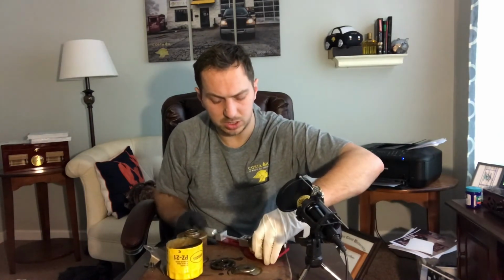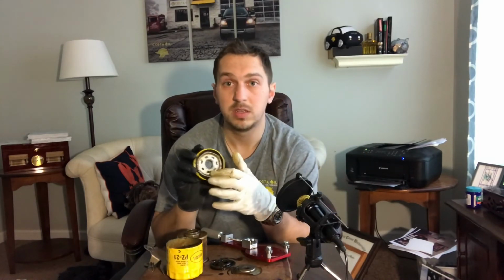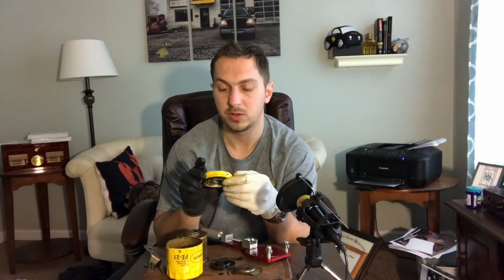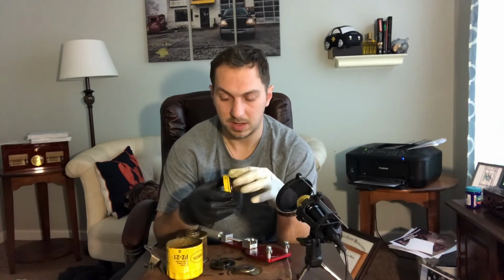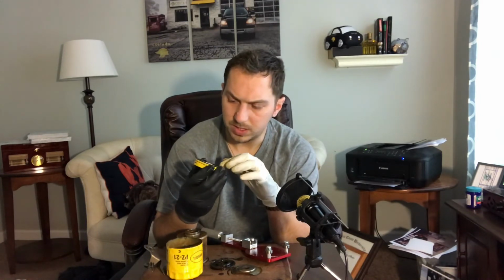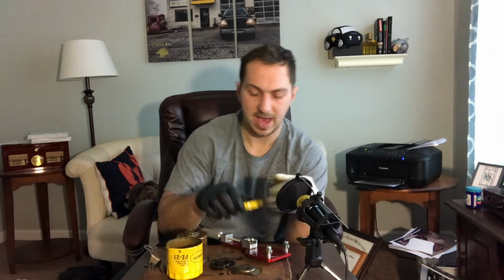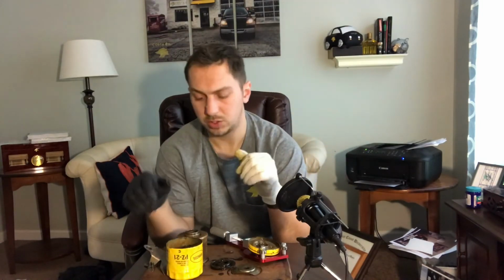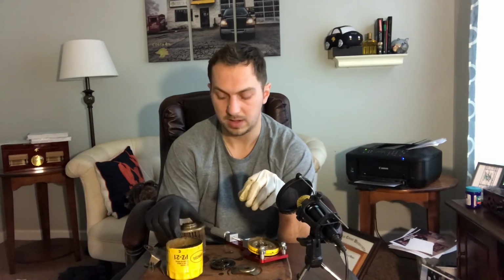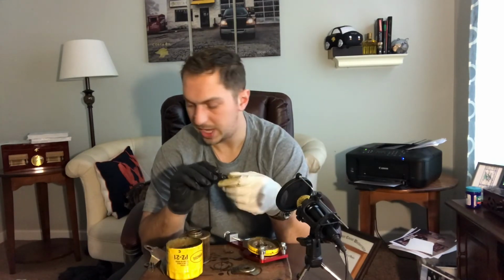We'll start with the base plate. The base plate is still in good shape. The gasket is still on it. It's got the same 7 drain back openings. These openings are in the same oval shape as the Motorcraft filter. This steel base plate is in good condition. It's a really tough base plate compared to some of the other base plates that I have open. Actually, before I get too much further, this came off a 2009 Dodge Grand Caravan. The silicone anti-drain back valve is in good shape.